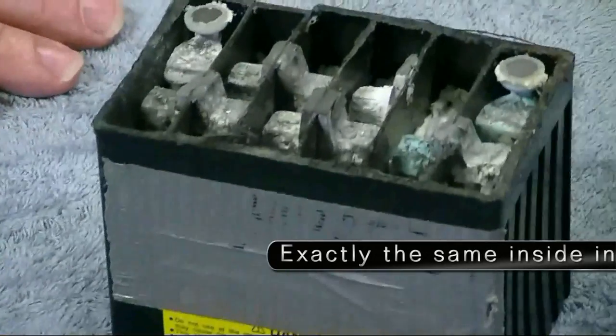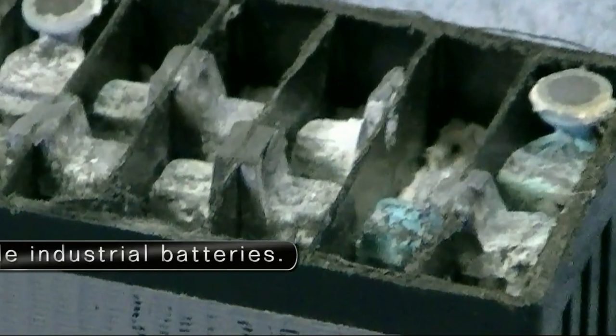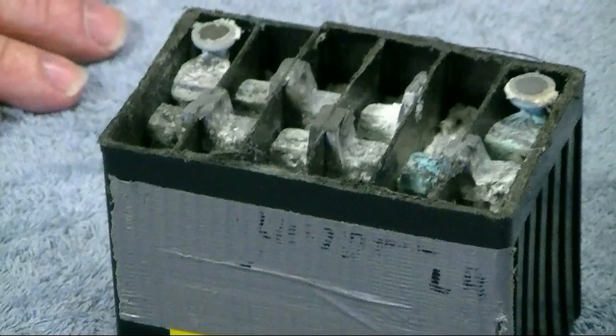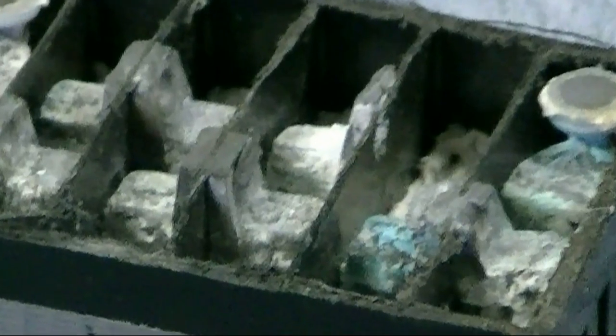Today we brought in a little sample of a battery here that folks can take a look at. This thing has really got some corrosion going on, and sometimes people don't see what's going on inside the battery, but this has been opened up to let people see that. Larry saw how sulfated it was, so instead of trying to treat it, he thought it would be a good display model. He cut the top off of it, and as they get around the trade shows, he's finding a lot of interest from people who've never seen what a battery looks like and these issues called sulfation.